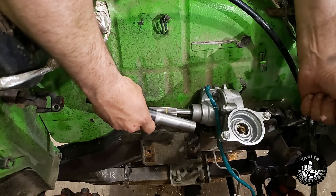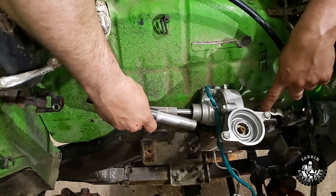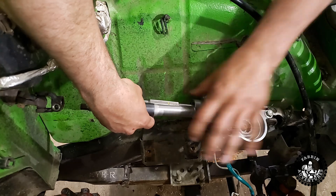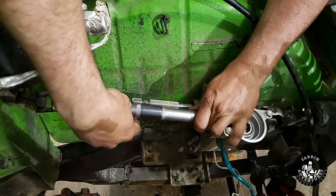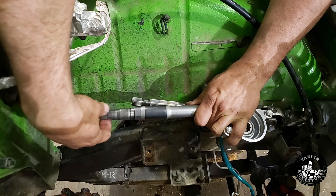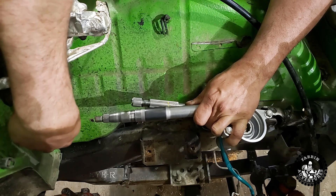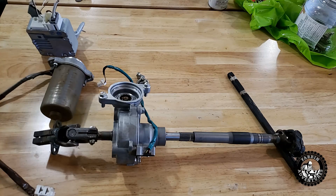That's all you'd need, and there's for sure three inches of stroke here. To remove it you just have to undo this bolt and slide the whole assembly — you only have to slide it three-quarters of an inch and it's out. I'm going to do that instead of what the other guys are doing — cutting the original shaft. I'll just take this U-joint out, drill the hole a little bit so the splines slide in there, or grind the splines down so they slip in, and then just weld it to that U-joint.